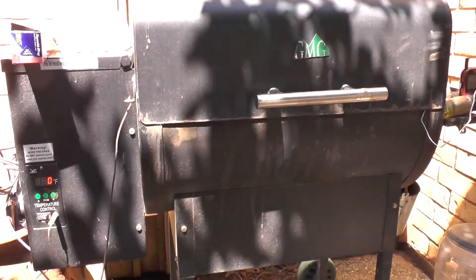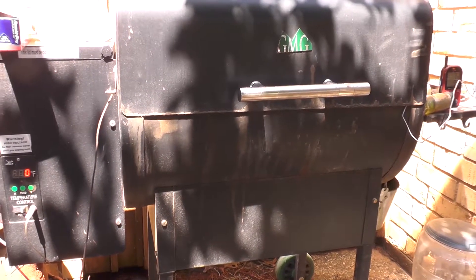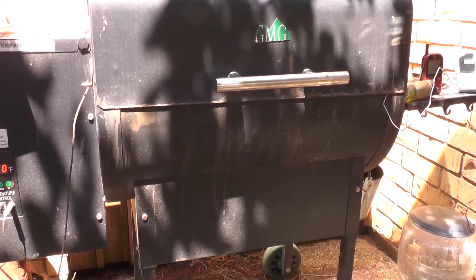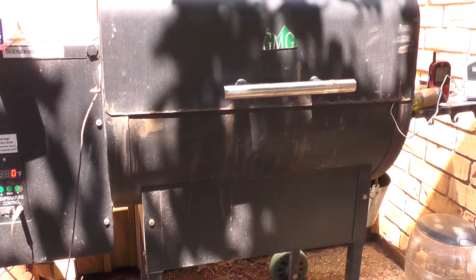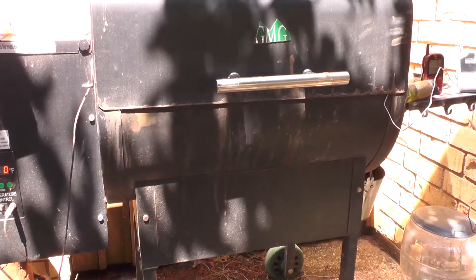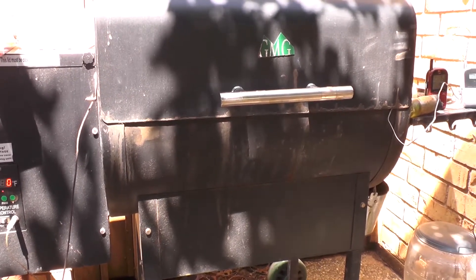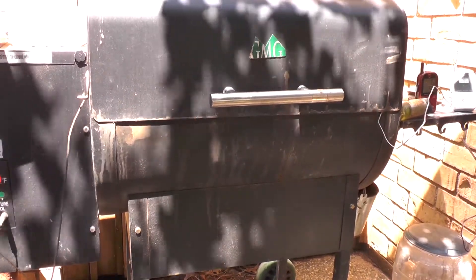The Green Mountain Grill will now go through its setup. For the next minute to 90 seconds, the auger feeds wood pellets into the middle. After that, it will start heating up the heat rod in that pot to catch the wood pellets on fire. Then it will kick on the fan — when you blow on coals, how they turn into flames — the wood that's already caught on fire will stay on fire and actually kind of looks like the Batmobile going off. And then it will attain temperature.